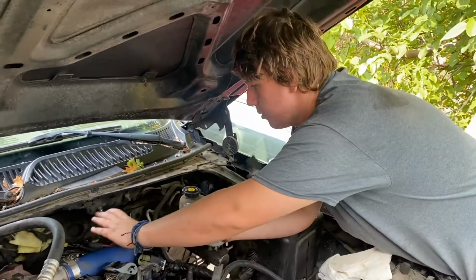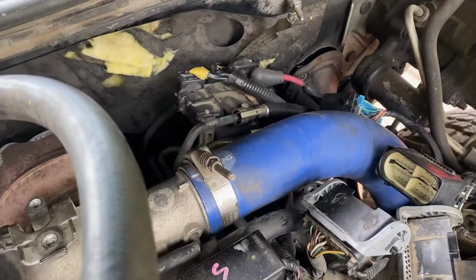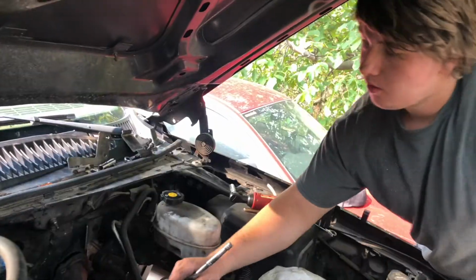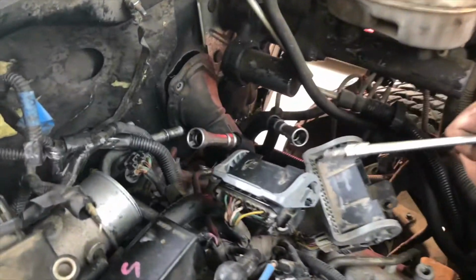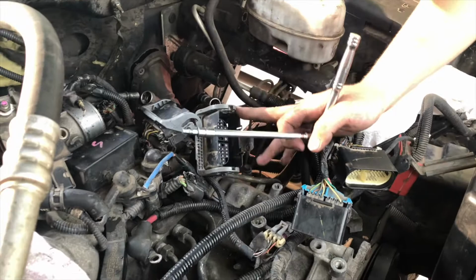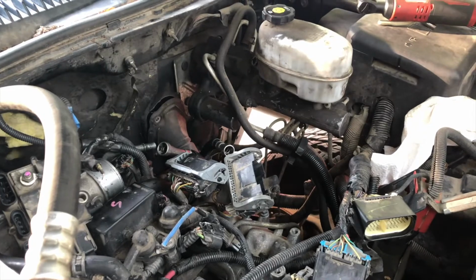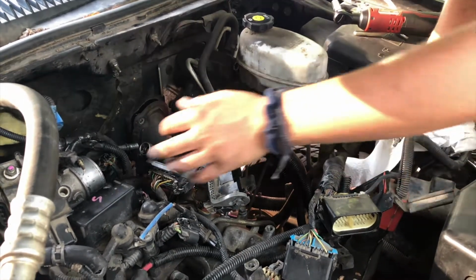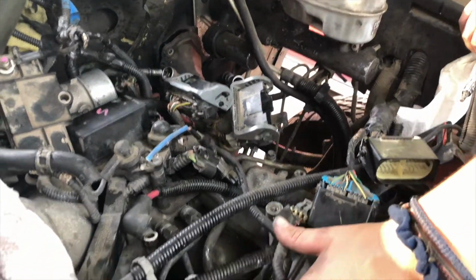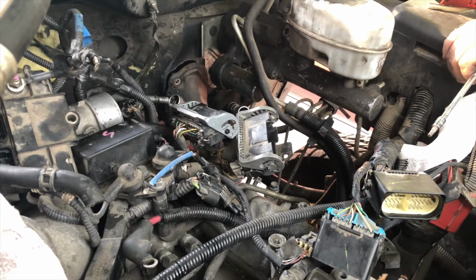Next is going to be our boost pipe, and then fuel lines and our thickum bracket and all that stuff. So that's how all that stuff goes together. We just got everything out of the way. We got our fuel lines disconnected, like I said. Got the ECM, the big bell connectors off, the bracket for them, and then we undid the glow plug module. Everything's pretty easy to undo. We got the glow plug harness undone from all the glow plugs and wrapped up in there. Oh, and we got the thermostat pipe and everything. All that whole coolant pipe, that upper rad hose is all taken off.